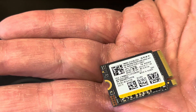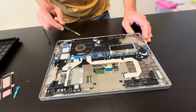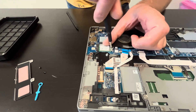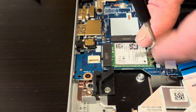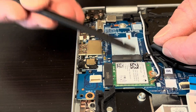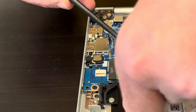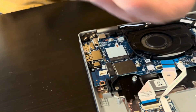That's our drive. Now let's take out the Wi-Fi card. So if your Wi-Fi doesn't work, you can replace this card. Gently disconnect the wires for the antenna, now we can take out the card. Here we have the part number and the model number.